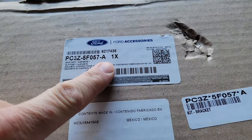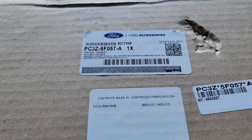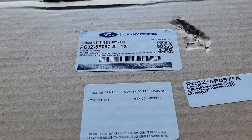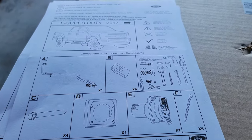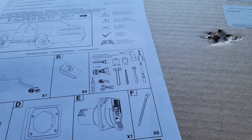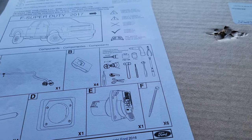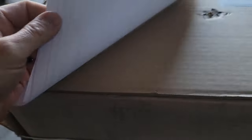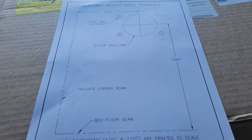The kit has almost the identical part number as last time; they've added an 'A' suffix — one kit. I'll link that Ford part number down below. I also printed out my old instructions because the last kit didn't include instructions for adding the seven pin. In the previous kit for my '22, it did not come with a four pin — only the seven. So if you need a four pin for a camper shell or something, you can just buy an adapter.